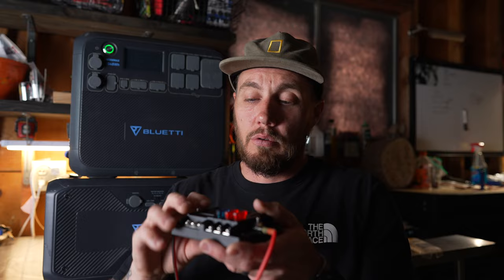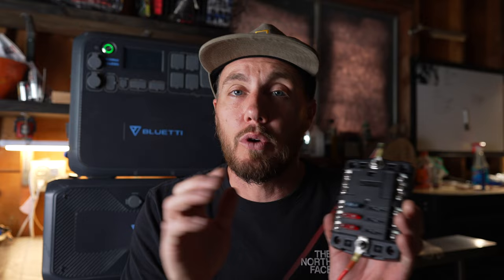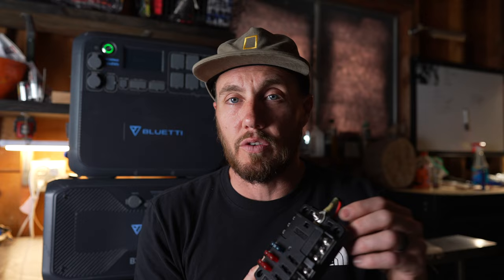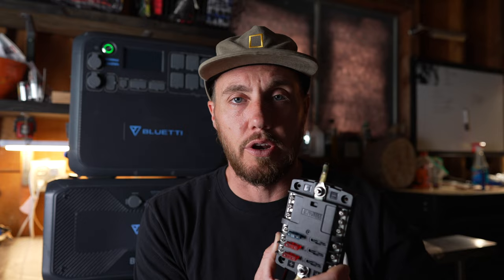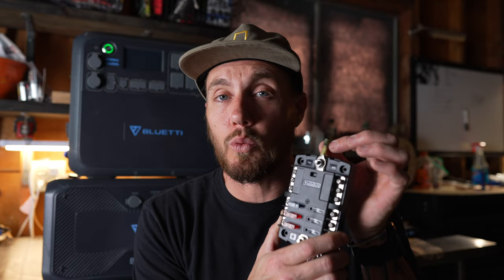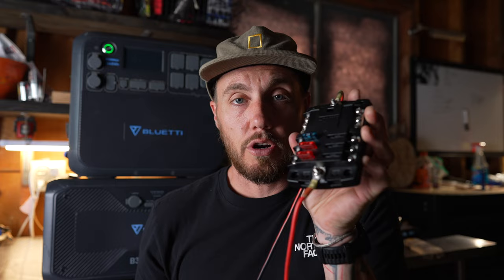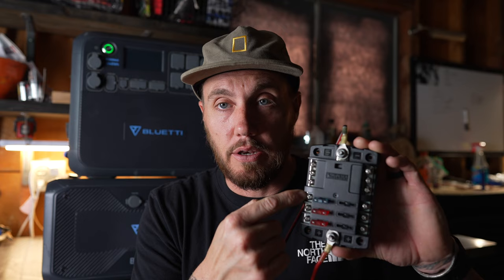Super simple. Then you go down to the Blue Sea component fuse panel. I would always recommend using heat shrink type connectors because they just take a beating and you don't have to worry about them rattling out or coming loose over time. The ones that you just crimp together and put black heat shrink over — I haven't had the best experience with those. I want to set it and forget it, and that's what these type of crimps will allow you to do. Your power goes on the bottom and your negative goes on the top on the negative terminal. Once those are connected, you have six power outlets and six negatives. You simply put your power into power, your negative into negative, and then connect your wires to whatever component.